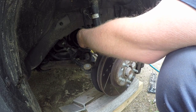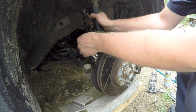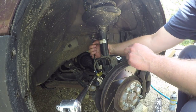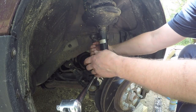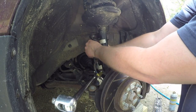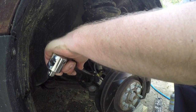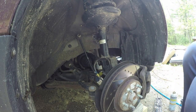I forgot about this line — this must be for the ABS. I forgot to spray more penetrant on it too. This might be a good time to break for lunch and let that soak. The lower end of the stabilizer link is attached to something almost like a torsion bar that connects the two sides of the vehicle. It's kind of spring-loaded, so it's putting upward force on the bar, which makes removing it difficult. I just stick something long in here to pry down, take some of the tension off, and it pops right out.